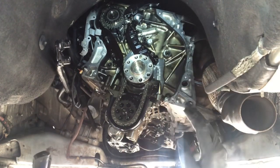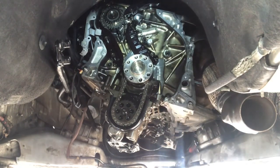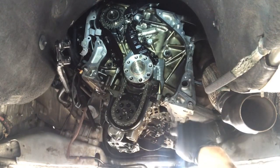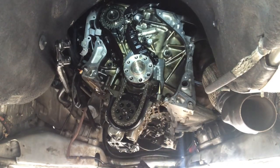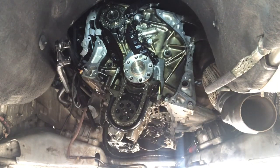To get to this point was not so easy. The sump is now removed and there's a lot of bolts and just a lot of fiddling to get them all out. I didn't remove any cross members or anything underneath - just used lots of different universal joints, extensions and things. You can do it with a normal tool set, you just got to have a bit of patience. So the sump is out.